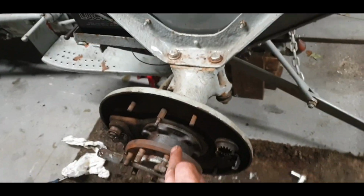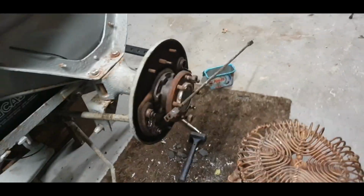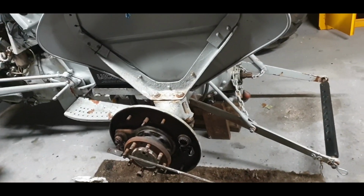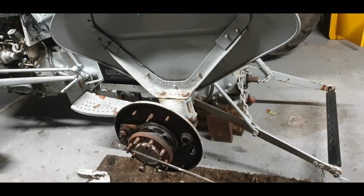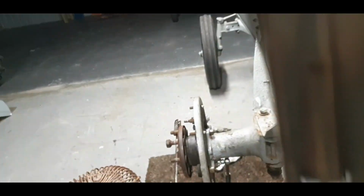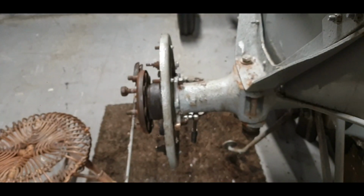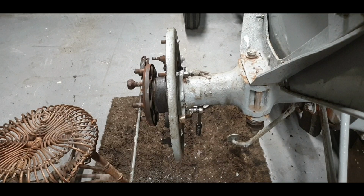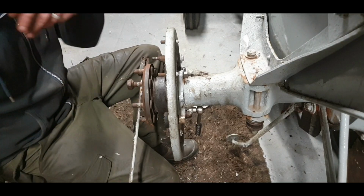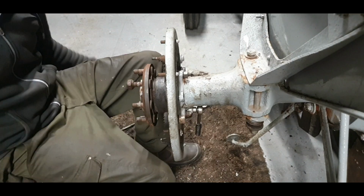But to be honest with you, I don't see the point of having a gasket on one side of this backing plate, where it meets here, and not having the other side when all that should be in there is grease. So that's why, when I clean off the gaskets, I don't put them back on. I think you can buy them, but you don't need them, and I don't like gaskets because they squash. So you could have your end float shimmed up right, and you put on your gasket, and what happens? You're tightening away, thinking you're after doing a mighty job, and next week your 2 half shafts are butting, and you end up down the road with something similar to what happened in 35X when I took it apart.